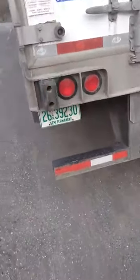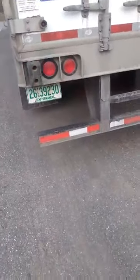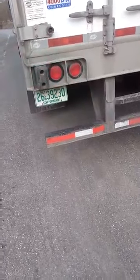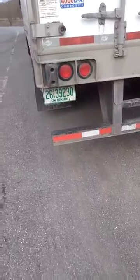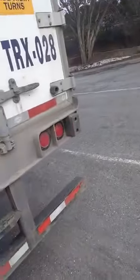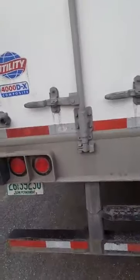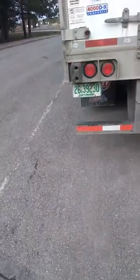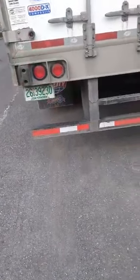Best thing to do is turn your park lights on, come around, and check all your lights. Then go back up and hook a bungee cord onto your trolley handle for your brake down to hold it engaged all the way down, and turn your four-ways on. Come back and make sure your four-ways are working and your brake lights are on. While you're back here, listen for air leaks on the trailer — that'll basically kill two birds with one stone.